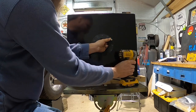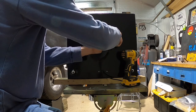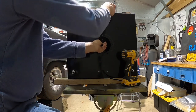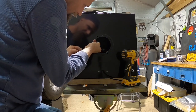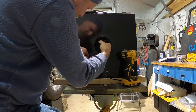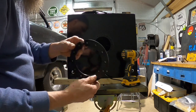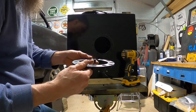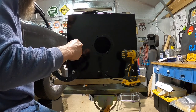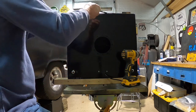This is the second time I've taken this apart. The last time I took it apart I did not have to clock this or anything — there's no particular way it goes in. I thought that was threaded plastic but it's been a few months since I took it off, and it turns out they are metal insert nuts — nylock. So you can't just thread them right in, you just need a little assist getting them down in there. There's your backup flange that goes up inside the tank, a gasket on the outside, and the outer flange.